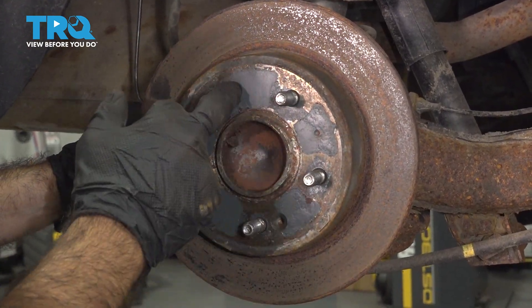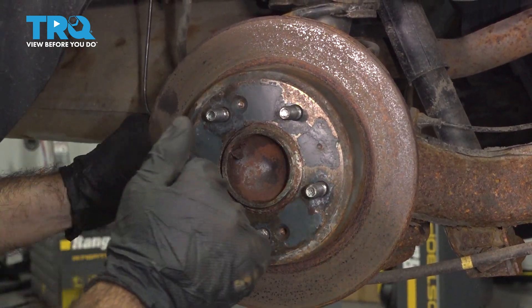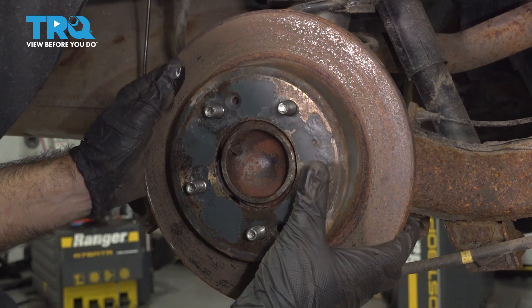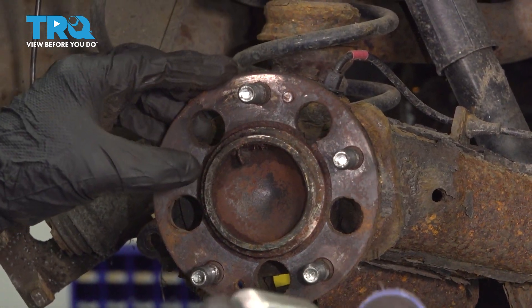We were going to take out our second Phillips head screw but before we received the vehicle, somebody broke it off. What we did is took a sledge and just hit our rotor a couple of times to break it off, and it broke free, and we can slide it right out. Our second screw has broken off — we're going to just grind that flat.